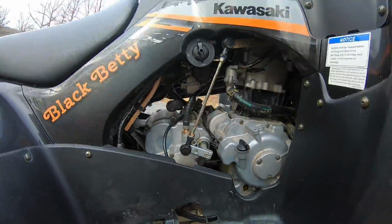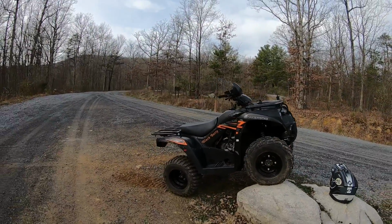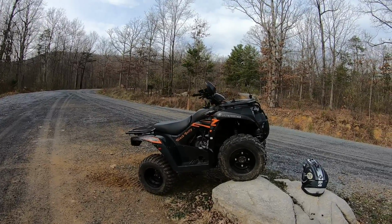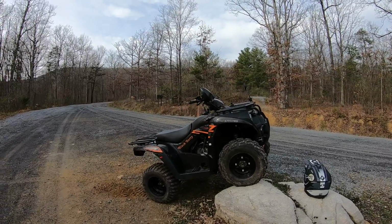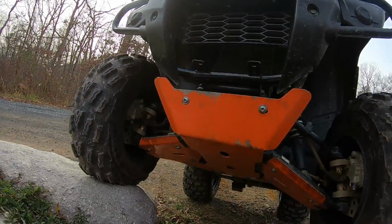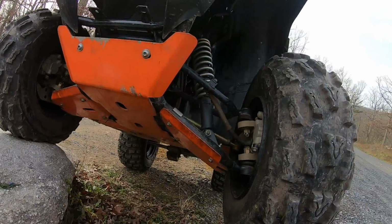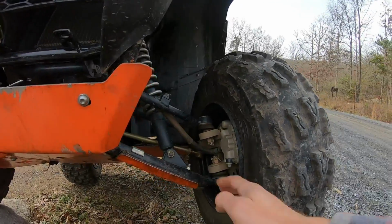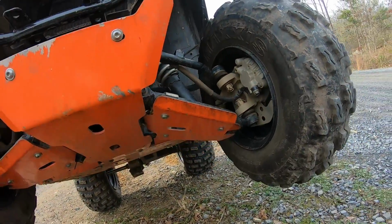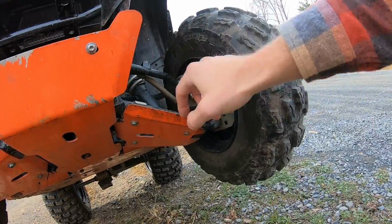Right, cut once. But I will say that for the 2020 Kodiak 450, I bought the entire skid plate package from Ricochet Off Road for them, and I didn't have to do any cutting whatsoever. That was a straight up bolt on, no drilling, no cutting, no trimming. There's one major difference in the A-arm skid plates on something that's only two-wheel drive versus something that has front-wheel drive axles. Because there's no boots over here, they kept the A-arm front leading edge pretty shallow, pretty short. And on something like the Kodiak 450, these things come up a lot higher and extend all the way out to protect your inner and outer boots.